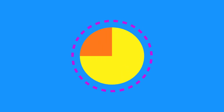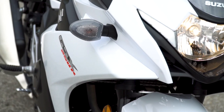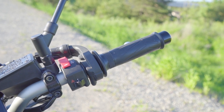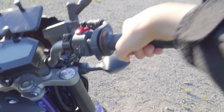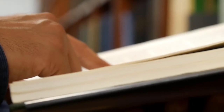In order to make our throttle more sensitive, we need to reduce the distance it takes our hand to fully actuate the throttle bodies. With most motorcycles, this is done by swapping out the throttle tube. A lot of bikes, especially those targeted towards beginners, come with a 90-degree turn throttle tube, which is completely adequate at least for the beginning. But as the rider gains more experience, the throttle will feel worse and more laggy over time as the skill level increases. So I decided to test three different throttle tubes in order to decide which one works the best.